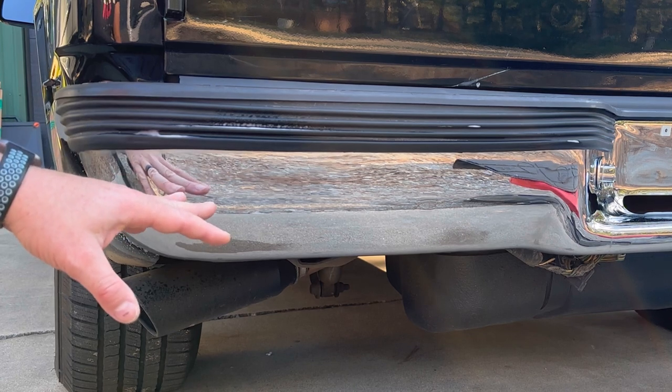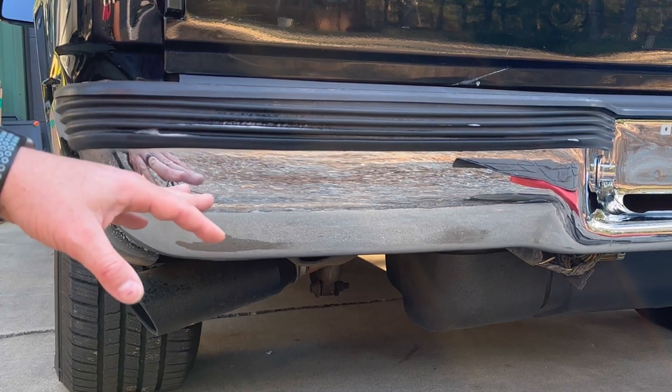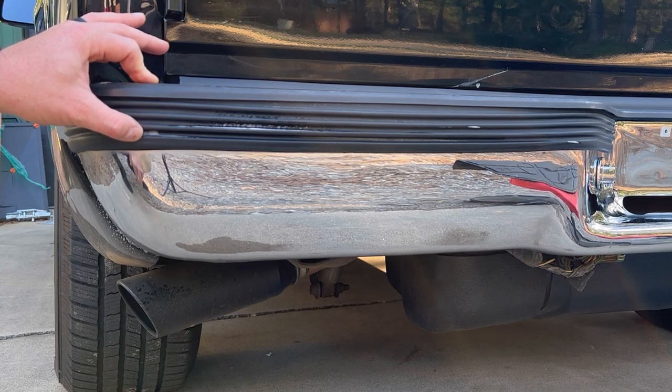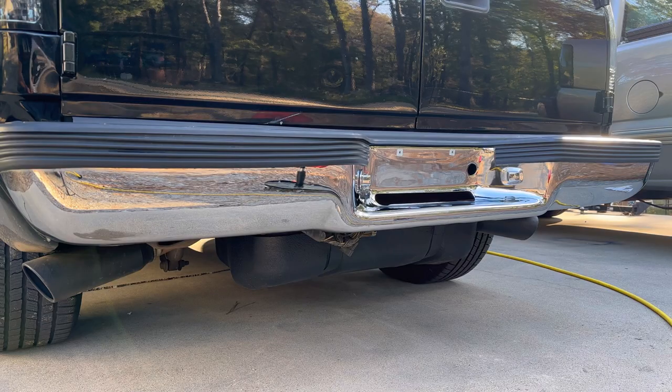After you get done wiping it with the prep spray, the next thing we're going to do is mask off around where we're going to spray the Hyperdip. After you get done wiping down the bumper with the prep spray, I recommend taking some compressed air and blowing around the molding and the license plate lights. Doing this will ensure that you don't have any pre-dip spray still sitting behind those things. If you had any liquid hiding behind there, then that would keep the Hyperdip from sticking.